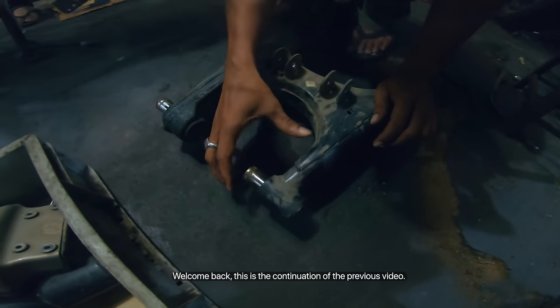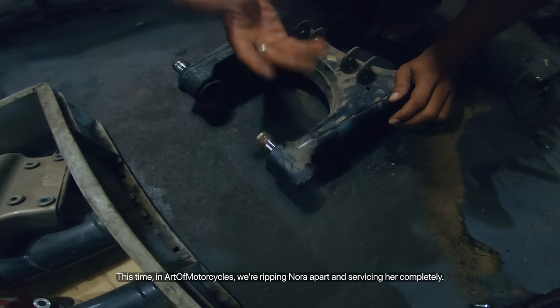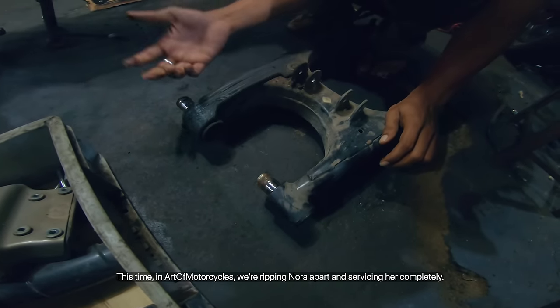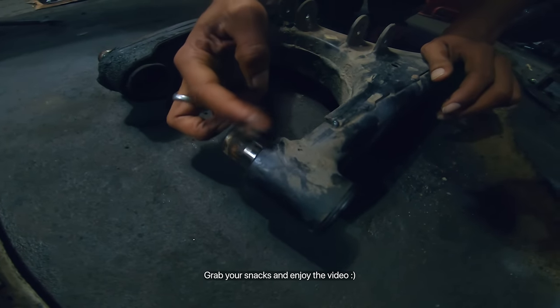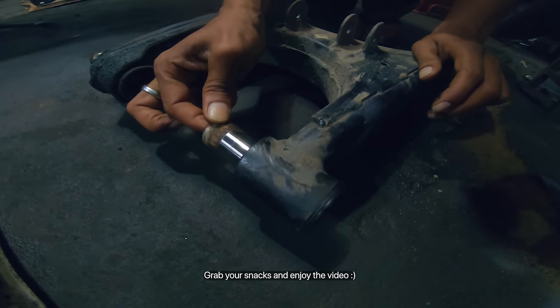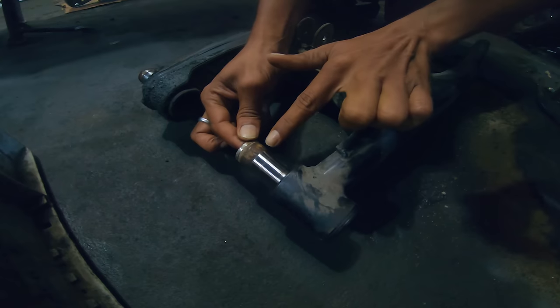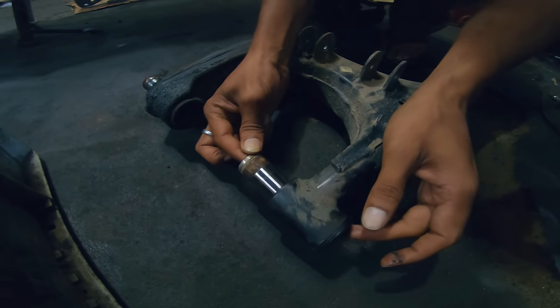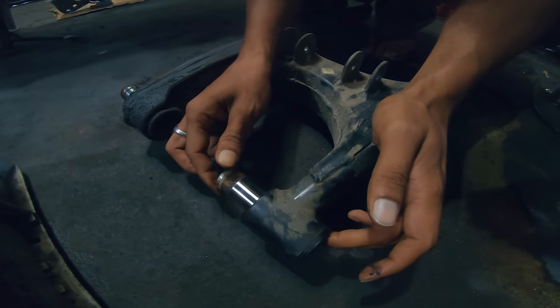Also, this swing arm part is a very main part, because it gets into action and goes up and down. So you see this rusting over this because you have bearings inside this. Okay, so very closely when you see how this part is, it's due for service because your bike has done more than 30,000 kilometers. So we'll be cleaning it, re-greasing and fixing it back.